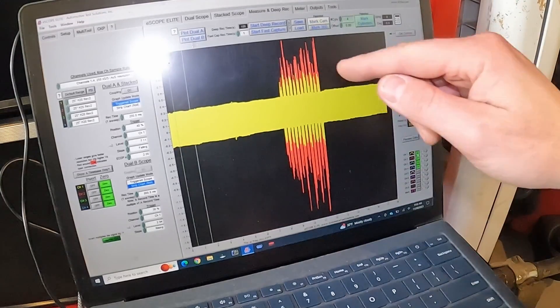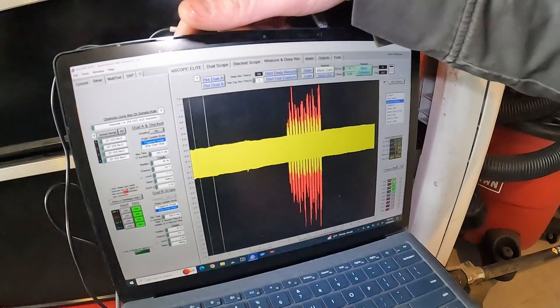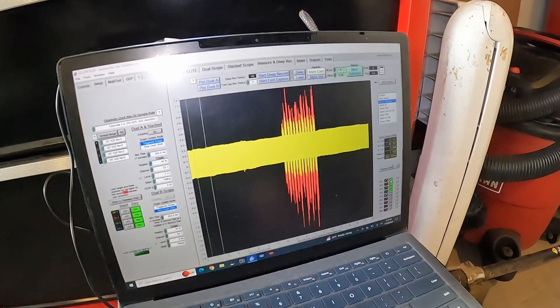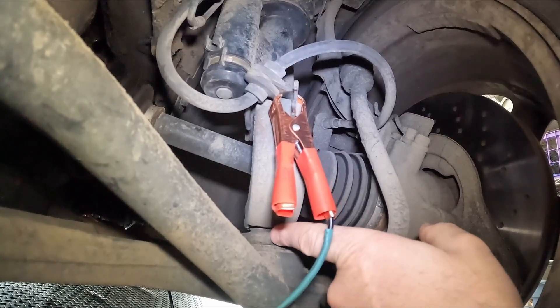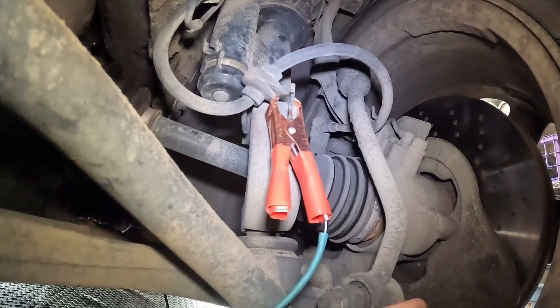That red is a lot more than the others, and our yellow is still quite a bit less. So our red — if we look in the back, our red is trace number two, which is the green cable. So now let's go under and see what green is hooked up to. Green is hooked up to our strut right here. There's a little joint that our strut is attached to, so this joint looks like it's making most of our noise.